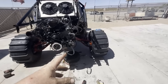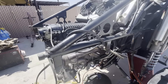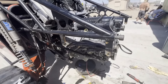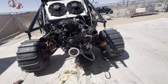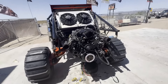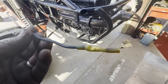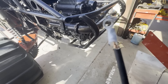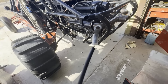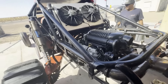It's a couple hours later. We checked under the oil pan - definitely a built motor - and got the motor back in. We shortened up some of the lines to make things a little easier to work on in this car. It looks like a lot of this stuff was added later - they added and added and added, then we had hoses looped through other hoses through electrical wiring. We're putting the power steering pump back on and routing the belt. Just getting ready to test fire it and the fuel pump wouldn't come on. Looking into the wiring we found a bad butt connector on the Aeromotive A1000. Those are very particular with voltage - when they start dropping voltage or you get loose connections like that they start running lean. So we're putting a new 10-gauge run to the pump, get it soldered up.